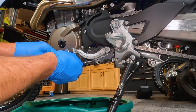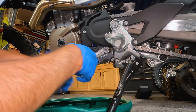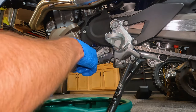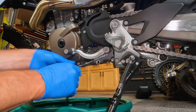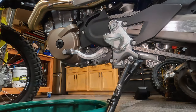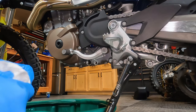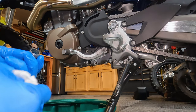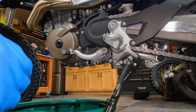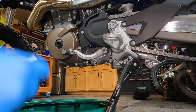The next thing we'll do is go ahead and remove this oil filter — or sorry, this isn't considered a filter, this is where those oil screens are. While that stuff drains out I'm going to go ahead and clean the screen plug. Just get it all nice and clean — like I was talking about, those metal shavings, there is quite a bit of them.